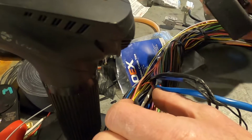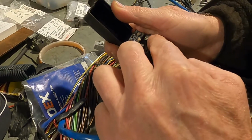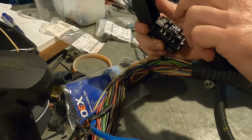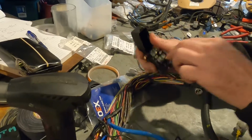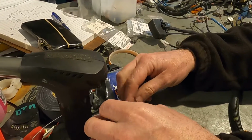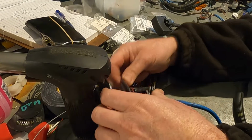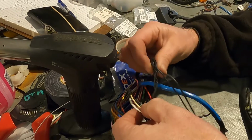They actually come up to the diagnostic box, OX1 and OX2 in the diagnostic box. What are they for? That's if you want to test your oxygen sensors. You can manually test them in there and read your millivolts. That's why there are these 4, but they're joined together.